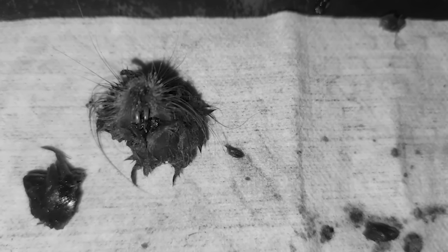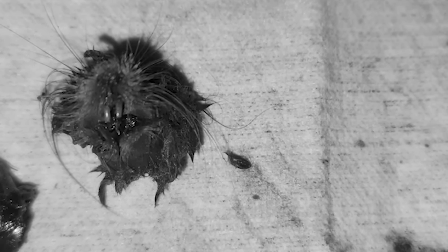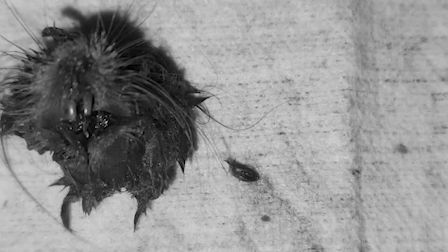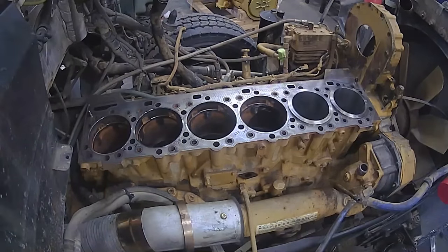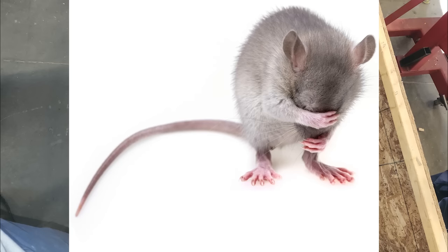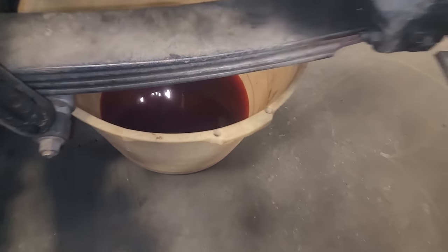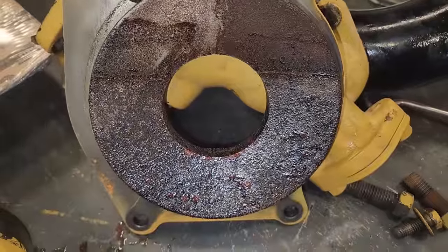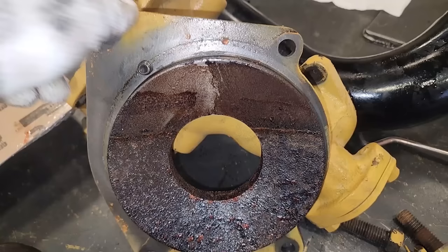So what the heck was blocking it off? As you can see — I put it in black and white so it doesn't look quite as graphic — it was not a rag. It was not sabotage. It was a poor little mouse. It must have been that during the course of the rebuild, the radiator assembly was removed. The radiator is new, so we know it was removed. During its removal, this poor little guy must have gotten into the expansion tank or one of the hoses, and when it was filled with coolant, he got stuck in there and did not have a good day. That caused an air bubble, which prevented coolant flow in the engine — that's why it caused an overheat, folks. Hope you enjoyed the video, thanks for watching.